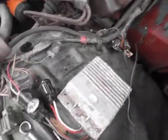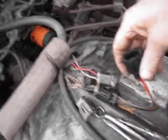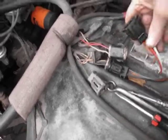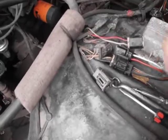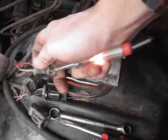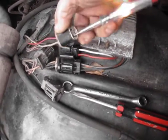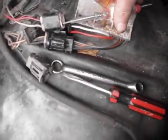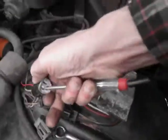We're going to find some keyed source, so we're going to go turn the key on. Key is on. I looked at the wiring harness and the wiring diagram in the manual. I believe this big thick white wire to be a positive 12-volt source. We're going to jam it in there - and sure enough, we got some voltage there. We don't know if it's 12 volts, but I'll check that in a minute. We'll go turn the key off and we'll see if that still lights up. Key is off - and no power.